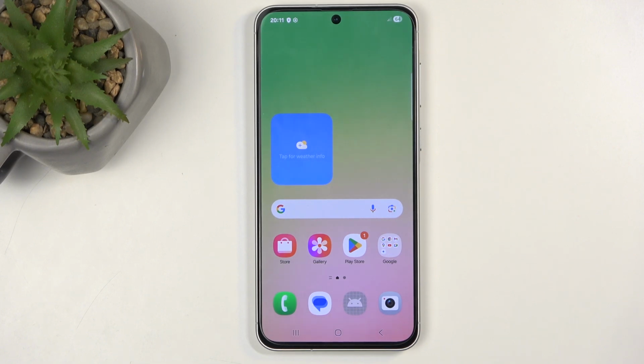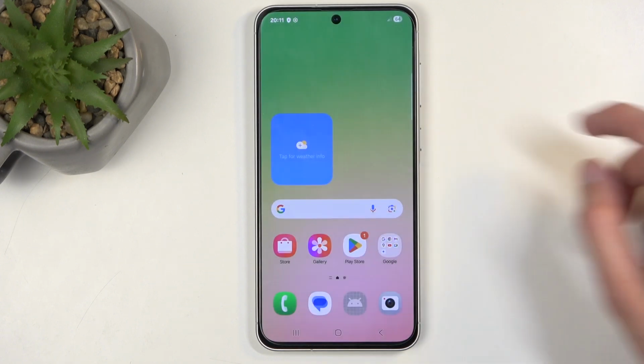Now, I also want to clarify this: if you're doing this to get rid of a screen lock that you don't know, chances are you will need to do a verification after the reset, which will require you to either provide the screen lock, which you don't know, or the Samsung or Google account. If you have a Samsung account and Google, it will default to Samsung, but if you don't have a Samsung account signed in on the device prior to the reset, it will then choose Google. And at this moment, this cannot be bypassed, so I ought to mention this for people that might be interested.